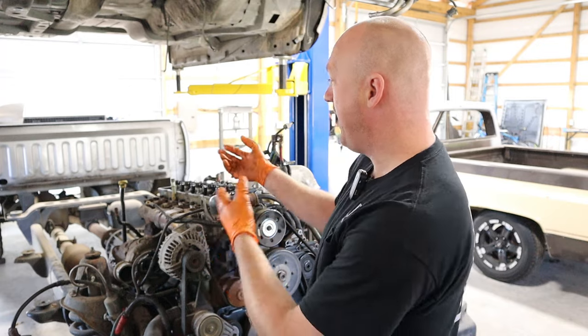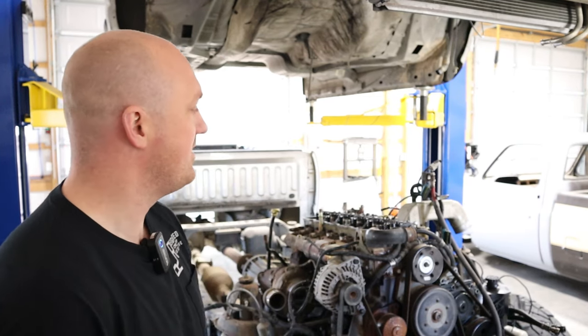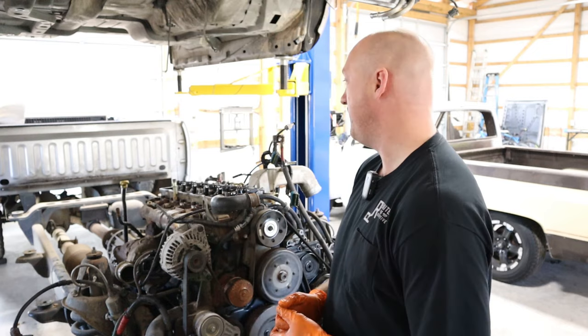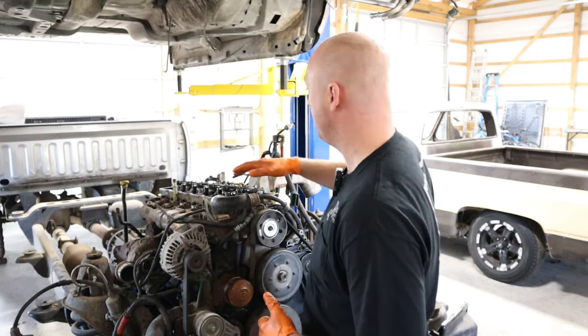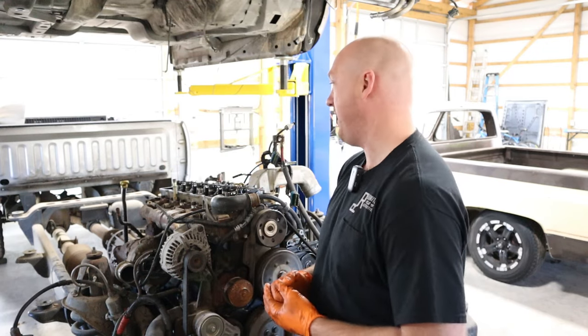I did a rebuild on this engine here, which you can also watch on my channel. So I'm going to check the valves just to be sure. I took everything off and put it right back where it came from, but I'm still going to go through the procedure to figure out exactly what my valve clearances are and make any adjustments if any are needed. One important point about doing this procedure is that you want to make sure the engine is cold, or as near to it as it can be. When heat is involved, things can swell and tolerances and clearances can change, so we want to be setting this when it's cold. For me, this procedure is going to be much, much simpler than average because I have the cab off of this truck right now, so I have really great access to all of the cylinders.